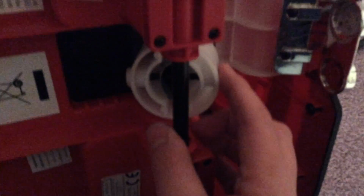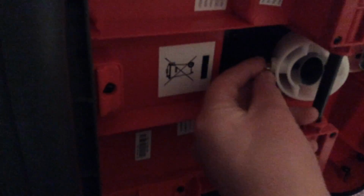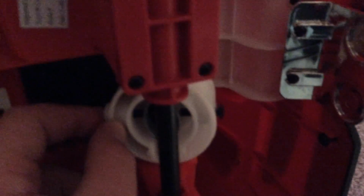You start putting the stick in, like so. You've got the square hole that way, facing towards the seat, and the circle facing towards the chrome exhaust. You get this bolt. You line it up, you put it straight through, like that. You get the square nut, which is there in my hand. You push it on gently, and then it should come out a little bit like that.